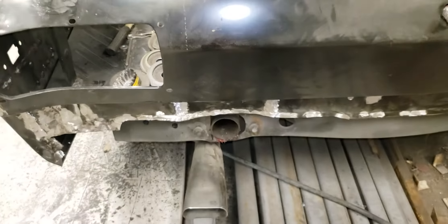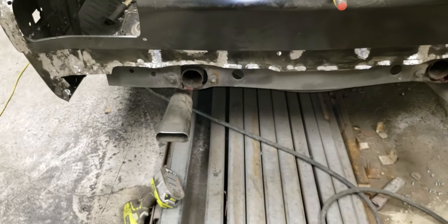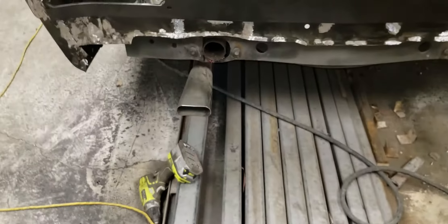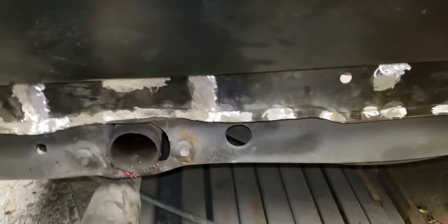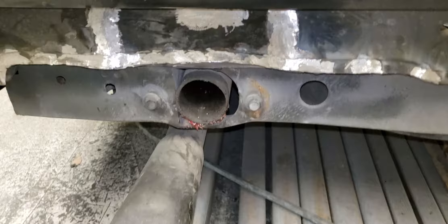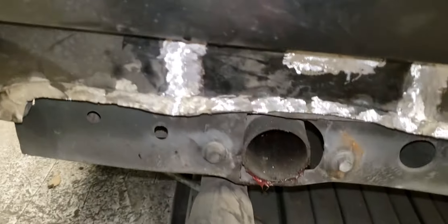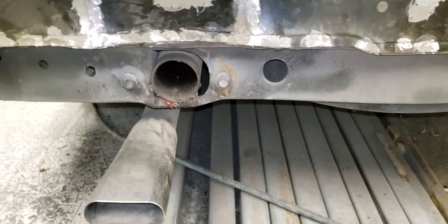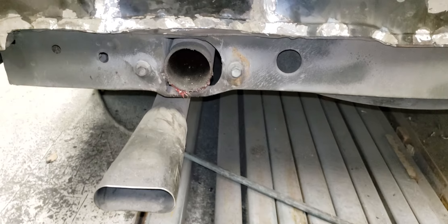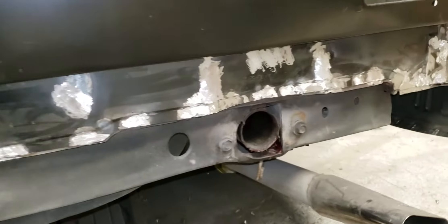So I was wondering, can I cut a piece off the other car and stick it in there and patch it in? But when I looked at it, it was rusted away too bad, so I couldn't use anything from it. I sat there and thought about it a while. I had it all mounted up with my self-tapping screws, and I thought, I'll just cut a little line there and there. I took my body hammer and knocked it in, made it curve in there, put the bumper on, test fit it, and everything fits and it's got room — same on the other side.